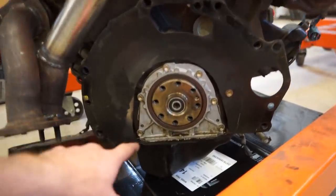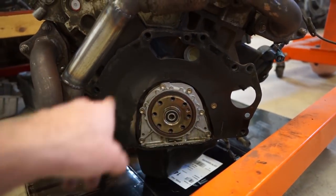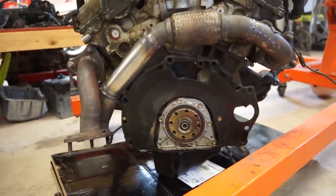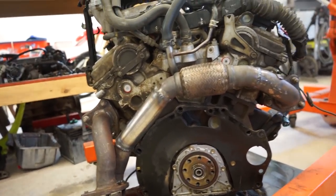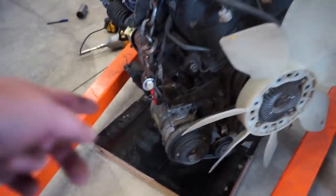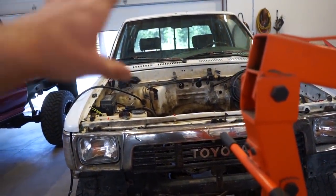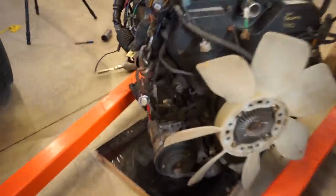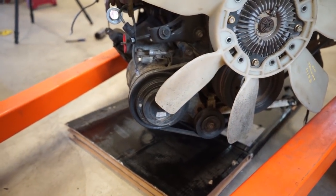The next thing is the rear main seal — I picked up a new seal, so I'm going to pull this whole plate off, unbolt it, reseal the plate, get the new seal in there. When everything else shows up, we can do the dipstick, pull the pan, get the pan sealed up, and get the dipstick relocated. I'm also going to pull the AC pump off, because obviously this truck has no AC and I really don't want to have to swap the whole HVAC unit under the dash, so I'm just going to run without it. That'll give us a little more room in the engine bay as well.